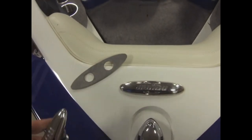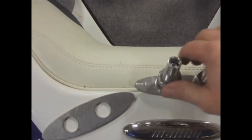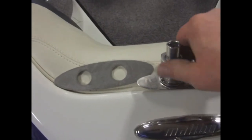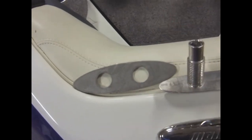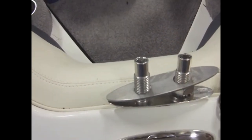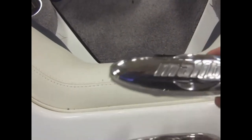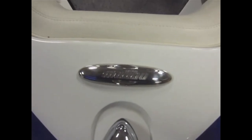We use a deck-mounted bow cleat to hold the bow strap in position over the top of the bow. The cleat is a very simple unit — it comes with a backing plate to reinforce underneath. Just remove the nuts and washers, drill two holes of appropriate size, put the backing plate on, and snug up the nuts. It's a very strong and simple way, and you'll find there are actually other uses for this cleat as well. Beware of the bow light wire — it tends to have a self-adhesive sticky holding the wire up underneath the deck, which tends to run directly across. You may need to remove that sticky piece between the upholstery and the bow light.